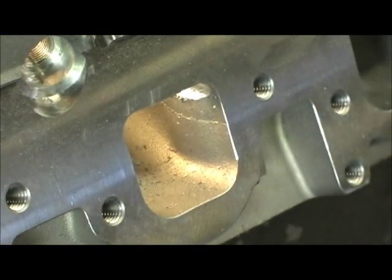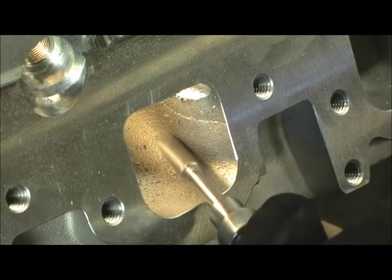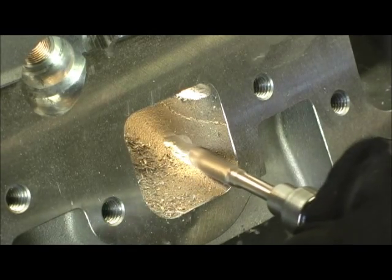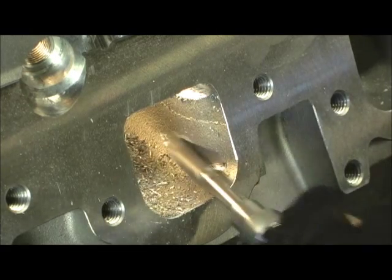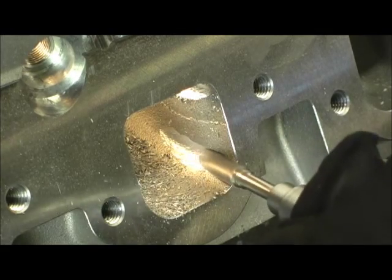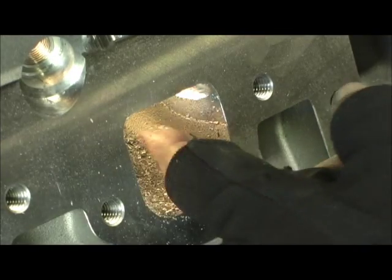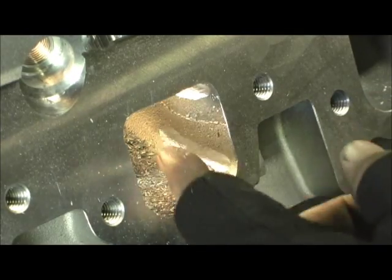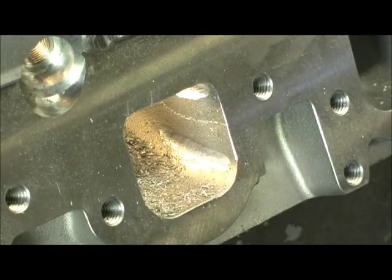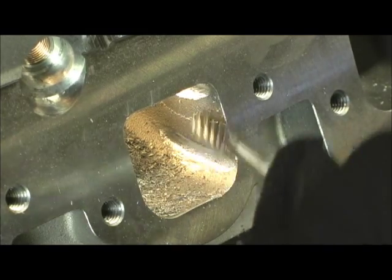Now I've got the head turned upside down and I'm going to come to the point, to the back, which I feel. Now I'm going to begin cutting in here. You'll be surprised at feel — just taking your finger and feeling the depth of the trench that you get out. That's where a lot of this is, and you're going to know you've got about the same amount cut out in the same distance. I know that might not sound very fine, but it's the way it is.